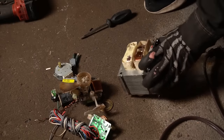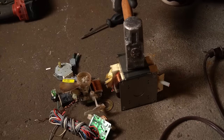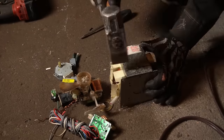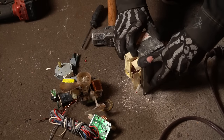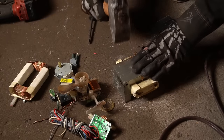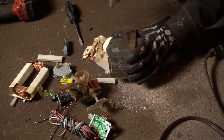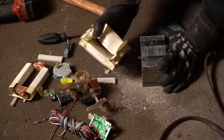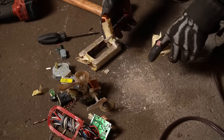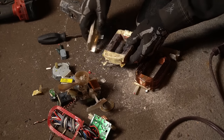If both sides were aluminum they would not be worth continuing disassembly, but if one is copper, disassembly is pretty simple. We just beat the heck out of the one weld to break it apart and expose the windings inside, which are then pretty simple to pound out. These are some of the easiest transformers to scrap. Peel the paper away — this is probably not necessary since you're likely to get the same price for copper even with extra paper on, as it won't be graded clean.